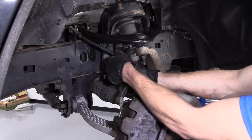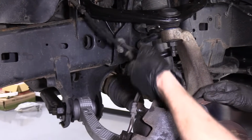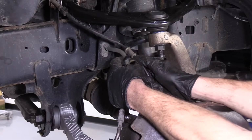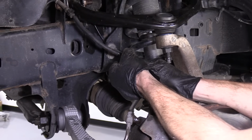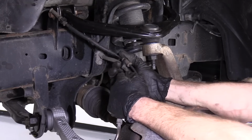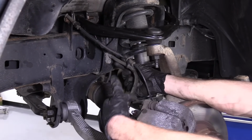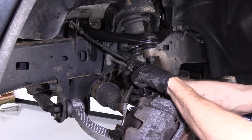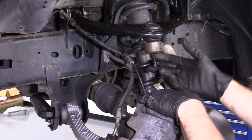If this clip right here was broken for some reason, maybe you broke it coming off, you don't want to leave your ABS cable just rattling around. If you have a little wire tie, you can go ahead and put that on there fairly loosely. Just enough so that it'll keep it adhered to the brake hose, but not necessarily to the point that it's going to pinch the brake hose. You don't want to pinch the brake hose. Fluid needs to flow. But this ABS wire does need to be mounted to the flex hose, so it doesn't go flopping around and get caught on anything.